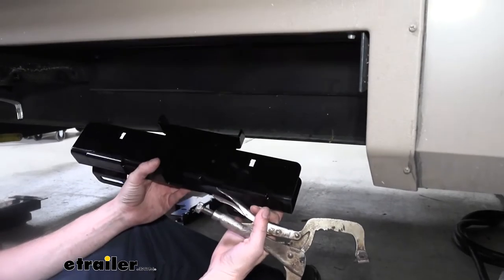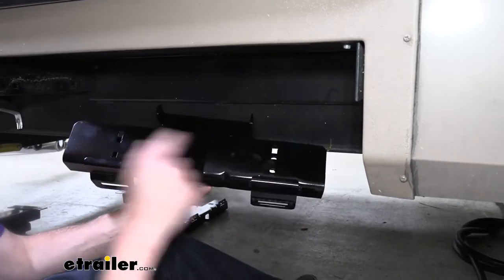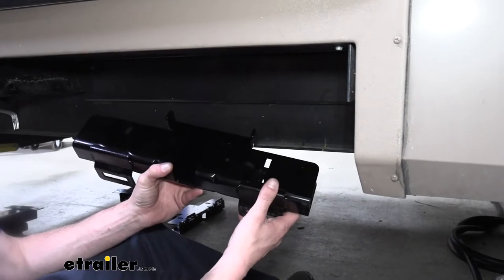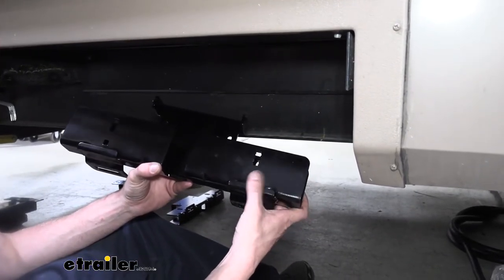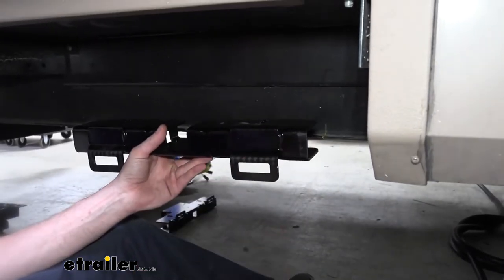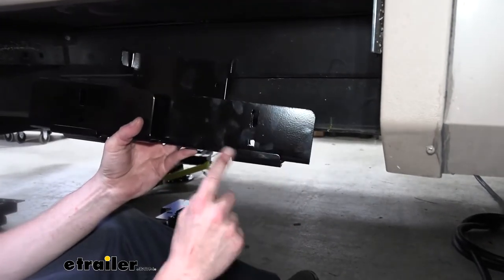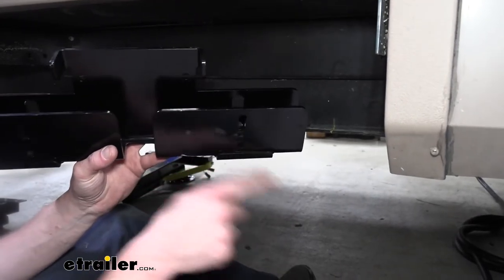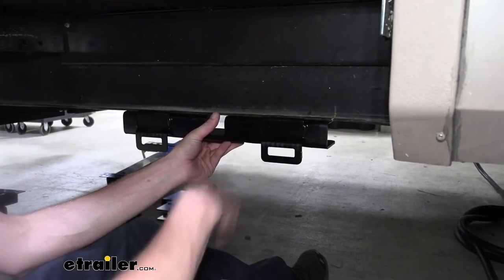So now we're going to hold up the bracket that our lifts install on. The square slots and square holes there are going to go up against the bottom of the I-beam, and we'll be drilling through the I-beam to secure it, and we'll use carriage bolts. This is the orientation it's gonna sit in, so these guys here are gonna hang down like that. If you look right here, where these pieces hang down, they actually stick up just a little bit and make a lip. That lip needs to butt up against the I-beam like that.